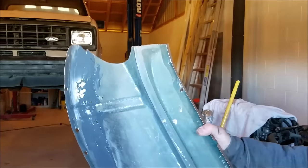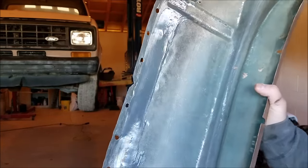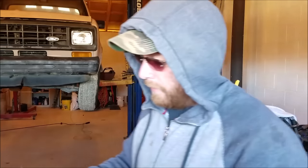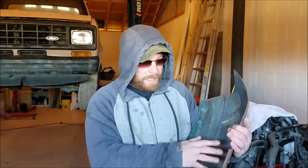So I want to do a little explanation on the JB Weld thing here. As you can see, it's all dried up here today. The reason I did that is because I don't feel a need to do any more to the inside of this panel than what I did. All I wanted to do was fill in those little holes or pits from welding and just smooth them out so water can't get in there.